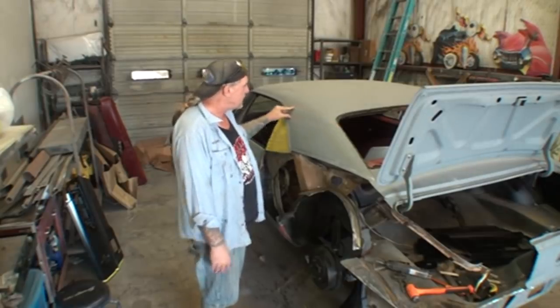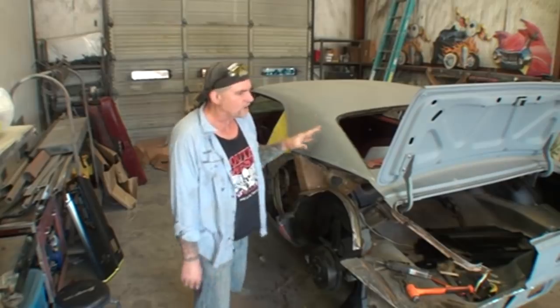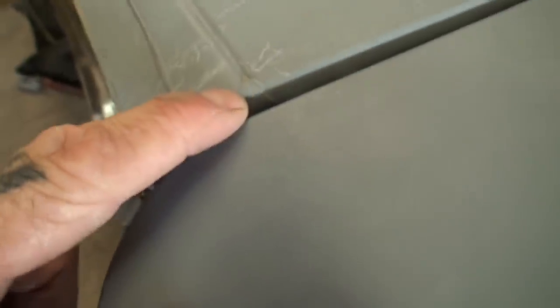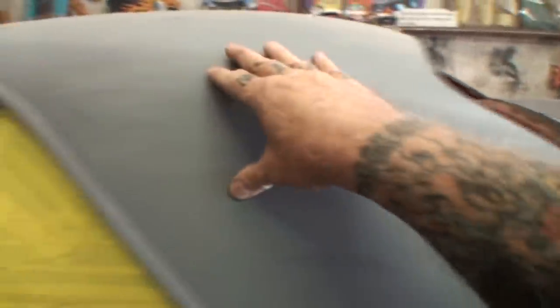That's one of the specific places that professionals in the game of collecting look — they want to know if there's lead there or if that quarter panel's been bondoed. So it's very important when you replace these quarter panels to leave this line on here and keep that factory weld that goes down into the trunk line there. You also want to keep that factory weld right there — it's very, very important to keep this section with lead if it is possible.